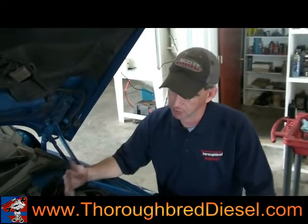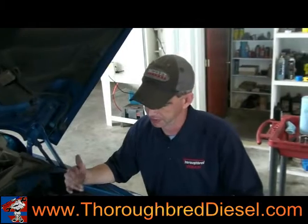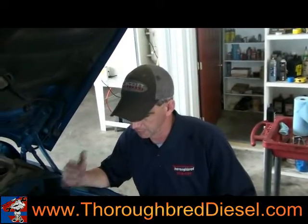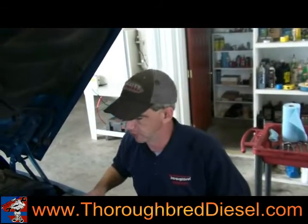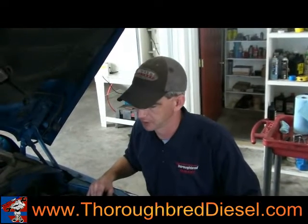Even more on that, I talk to so many people across the country that are running aggressive boxes like your Quadzilla Adrenaline or your Edge Comp box on stock lift pumps. So this pump is going to be the band-aid for a lot of our customers to get lift pump pressure up, and it's going to be a good lower cost alternative for some of our performance customers, so they don't have to buy that $600 or $700 full lift pump kit. They can get some fuel pressure and get running up and down the road. But it's also going to help a lot of our stock customers that don't have any performance upgrades done to their truck, and they just need fuel pressure to save the VP44.